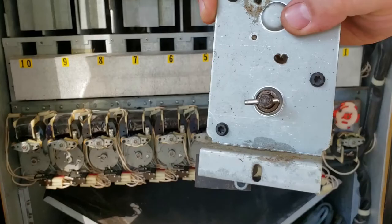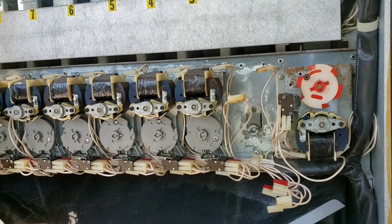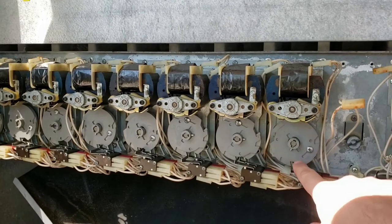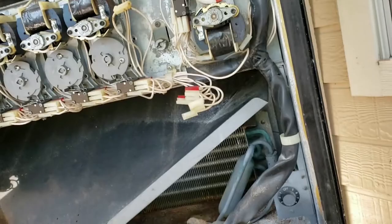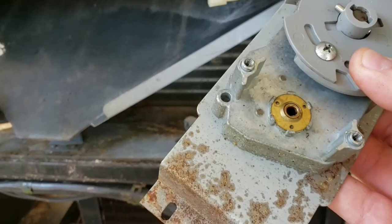On the backside, this gray ring has a pin in it, and that pin fits into this slot right here. When this spins, it's connected to this piece inside that's holding sodas and actually vends them out. So that's really the whole mechanism. On number eight that wasn't turning at all — the top motor was spinning, the piece up here was spinning, but the gray cam wasn't moving at all. Either the armature teeth are stripped off, or the gears inside this unit are stripped. So now I'm going to take this apart to see what those gears look like.